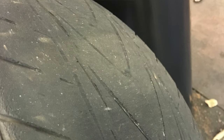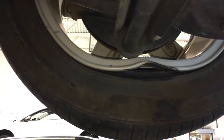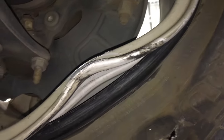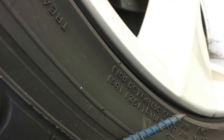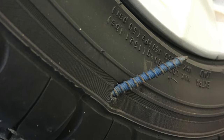Let's move on to tires — this one is incredibly important. This is literally the contact patch for our vehicles on the road. Do a very good, thorough inspection on each tire; don't just glance at the outer edges of the front tires. Get the car up in the air, probably a good opportunity while changing the oil, and look at each tire individually. We want to look for tread wear — if you're at 2/32nds, buy some new shoes. Look for dry rot, damage to the sidewalls, and uneven tire wear. A lot of us are in lowered cars, so make sure the inner edges of our tires are not showing cords — that creates an incredibly dangerous situation on wet mountain roads. Just like with brakes, if you're even close, this is the time to get some new tires.